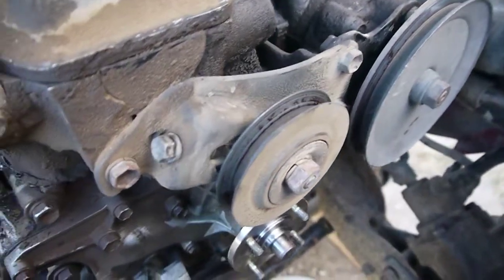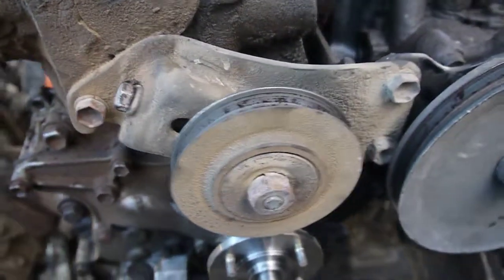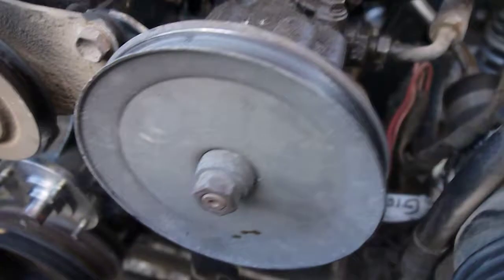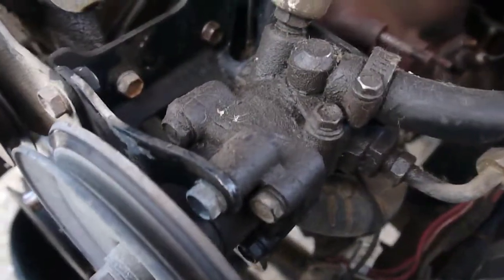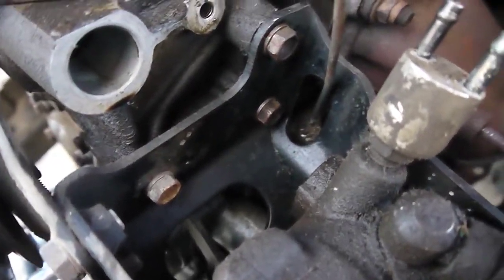Power steering pump. And the brackets on this are always the ones that trip me up. So here's a whole lot of footage of how this is. Pump sits down there, sort of in this cradle. 3 bolts into the head. On the back side, got a couple more. I don't know if it's light enough to tell, but there's one here, and then there's one here, and the one down here goes through this bracket, and that's the one that always really messes with me.